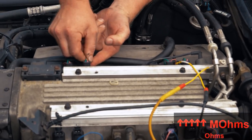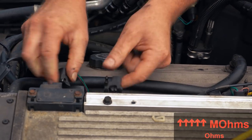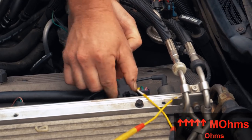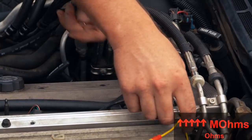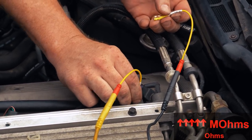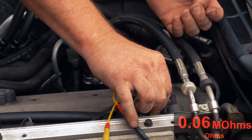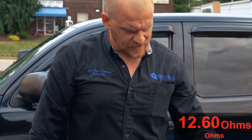And this is a group fired injection system, old school. I put some links in the description and in the little cards in this video for other group fired injection system videos I've done. I have some classroom lectures here too, right here on YouTube, where I'm showing how to test for these and why, on this design, this is the interesting part, a single shorted fuel injector can make this engine be a no start. 12.6 on that one.